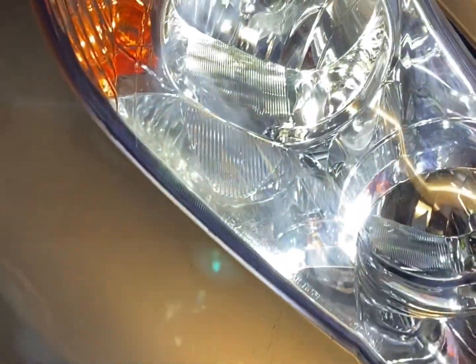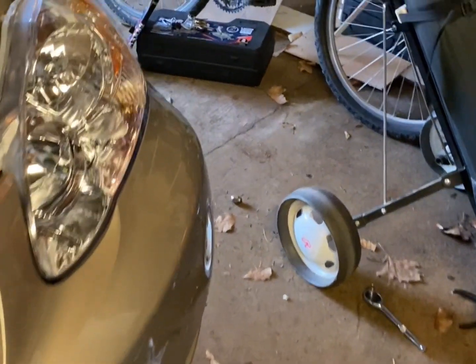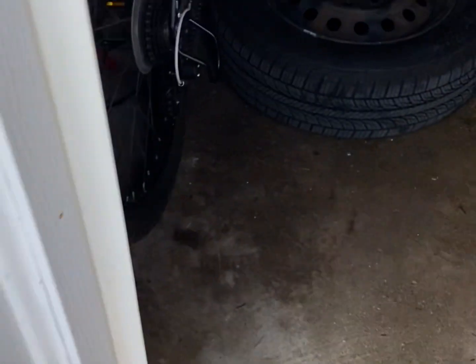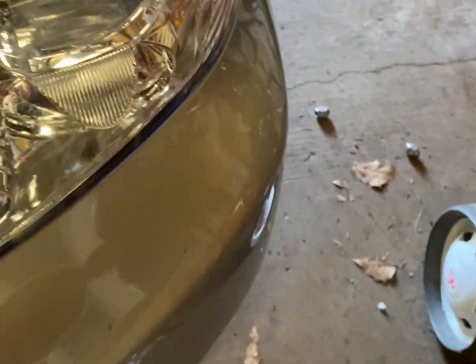Here's a quick rundown of the process. Once you take the tires off and jack the car up, there's a bolt right under the fender — when that bolt comes out you can move the fender. You need to do that because on the bottom side of the headlight assembly there's a clip — and on the old one you can see it clearly — with a bolt that you can't reach unless you bend the fender out. So: get the first bolt off, bend the fender out, get the second bolt off. Then the upper retaining clips come off easily and the whole fender flexes out so you can remove the headlight assembly.